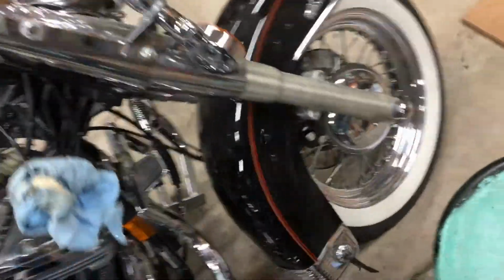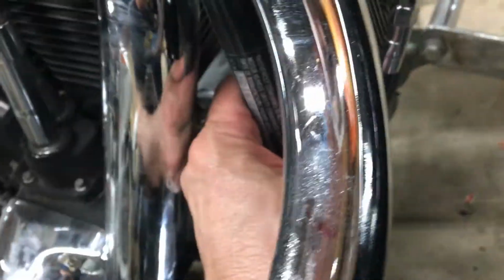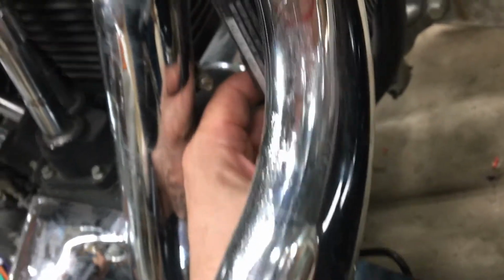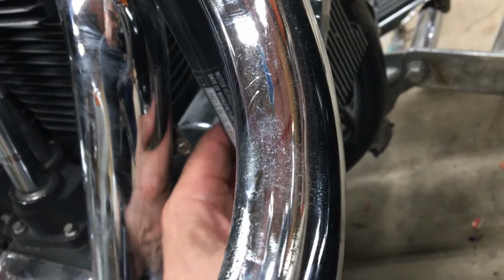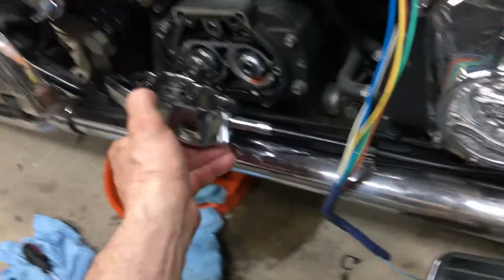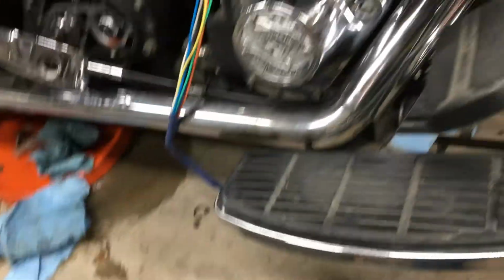And then, let's go this way. But in every case where this voltage regulator is here, I believe that is, and a lot of the bikes have the cross member right here, the clutch cable always goes underneath that cross member, or just underneath this regulator, and then it runs into the clamp down here under the derby cover, and then straight into the clutch mechanism like that. That's how I'm going to run it.